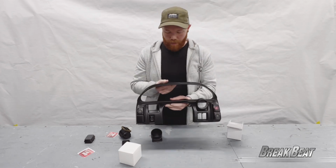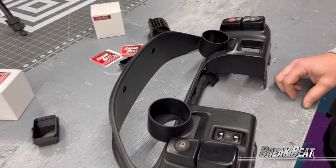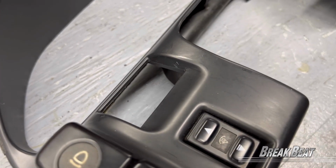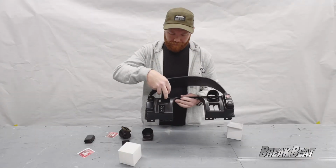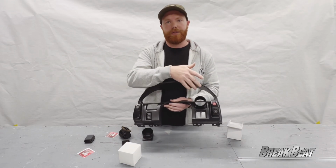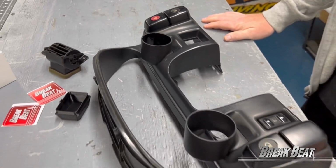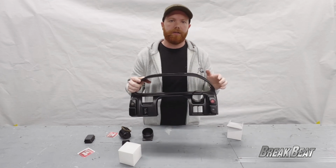You can go with 1 or 2, you know, if you got to run a boost gauge, if you want to run a CAN bus gauge. I know a lot of these newer standalone ECUs, Link, Haltech, they all offer a CAN bus gauge that has multiple parameter reads out. So you may only just need 1. You can run 1 or the other, you know, run a hand vent on 1, just you have preference on left or right. It's an easy, reversible solution if you don't want to run, you know, the full gauge screen, full race car stuff or anything like that.